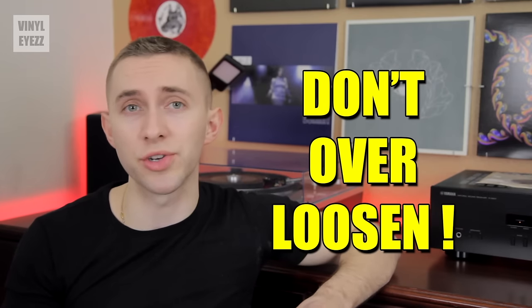Now that we're done with everything, the final step is to connect our turntable to the rest of our setup. But first we have to understand the vinyl audio setup. The basic vinyl audio setup has four important parts: first, the turntable; next, the preamplifier, or preamp; third, the amplifier; and finally, the speakers. It's very important to understand this basic chain — turntable, preamp, amplifier, and speakers. Some turntables have the preamp built in, but others don't, so it's very important to identify which type of turntable you have. If it has the preamp built in, you won't need to buy one and your setup will be easier.